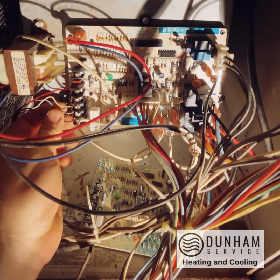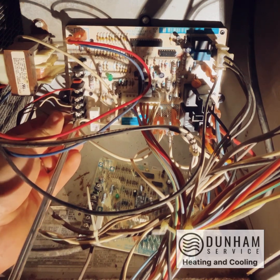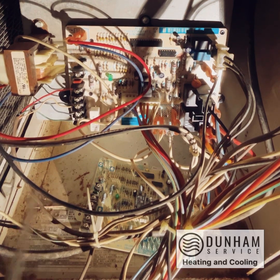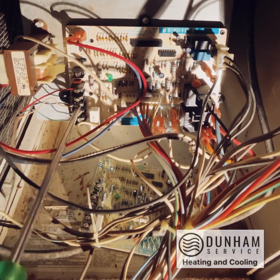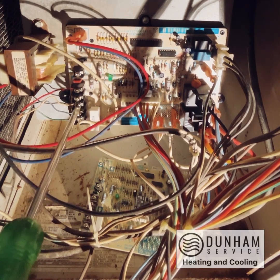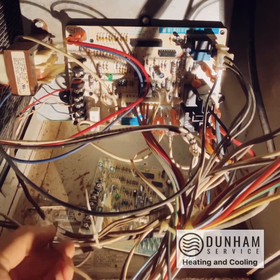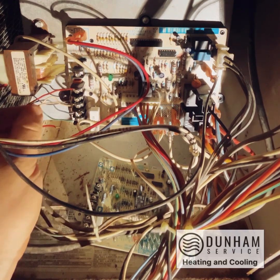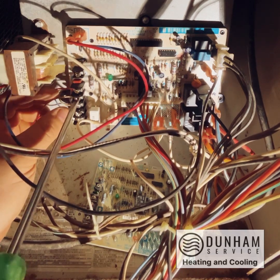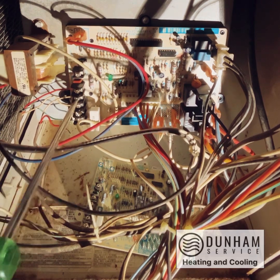W. And this is just a four-wire going upstairs. They're using blue for Y — that makes sense. I got a call this weekend from a buddy of mine who's replacing his thermostat. He said he put the blue on the OB and couldn't get the fan to come on. I asked how many wires he had — four. Red, blue, white, and green? Yep. Your blue goes on the Y terminal. Y stands for cooling, not yellow.